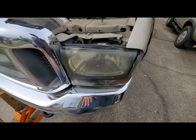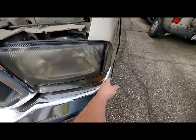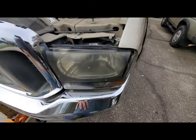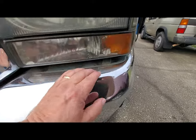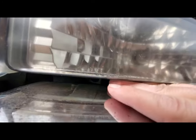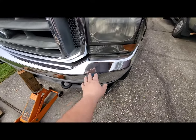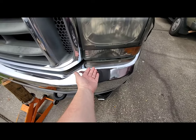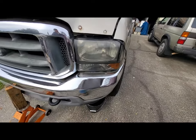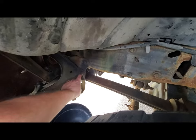You're going to have to get two sections out: the main headlight assembly and the parking light and side marker blinker assembly. To take them out you need to access the screws, which are right down here. One problem is that sometimes the bumper gets replaced and sits too high so you can't access those screws. I'll show you how to get to them via the wheel well.